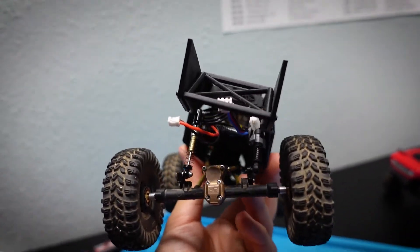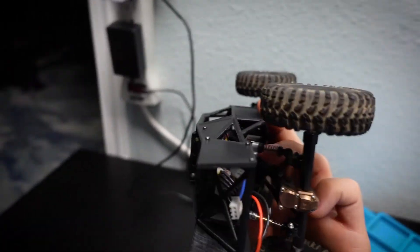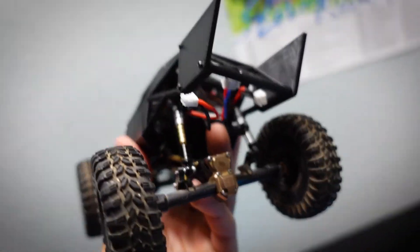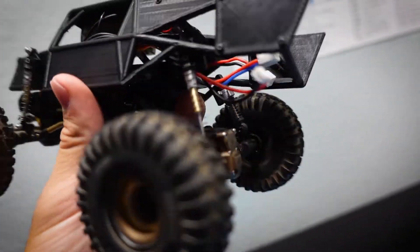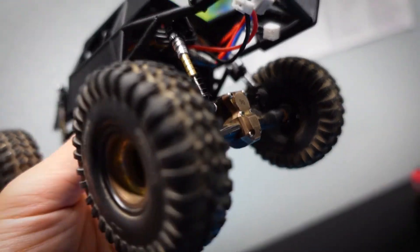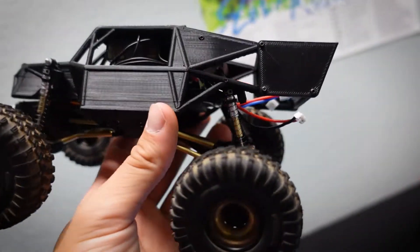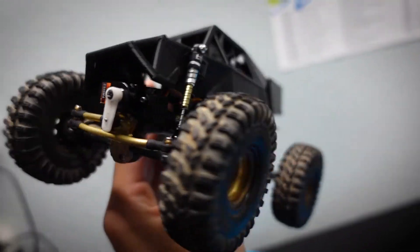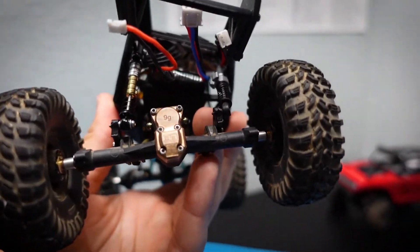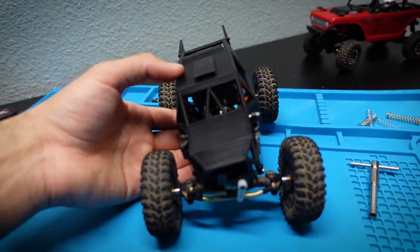You can really tell there's a big difference on this side compared to the stock shocks. I did want to note how much these were needed in the rear — there wasn't much movement back there because it's recommended to have double links and my C10 links were just too short, which was really restricting the rear movement. So I'm glad we went with these telescoping shocks because it's definitely making a difference in the rear. Two more to go and then we'll get this thing running.